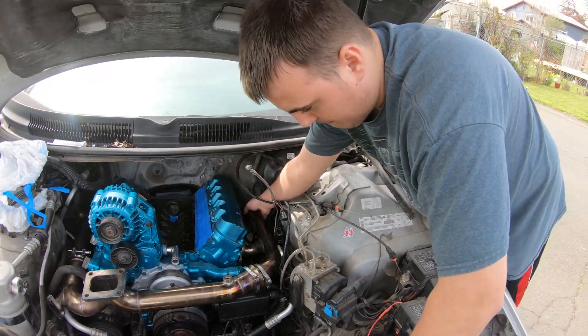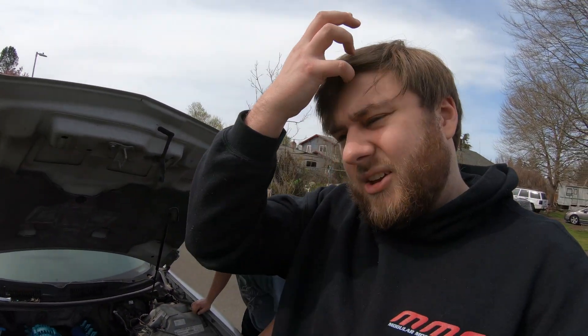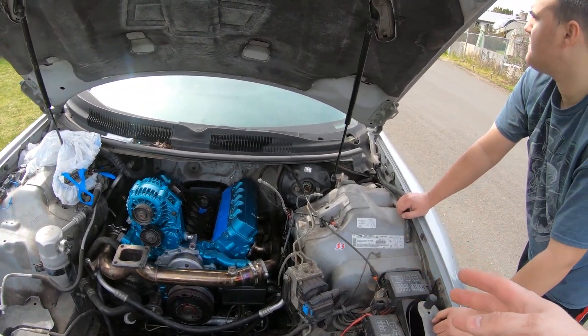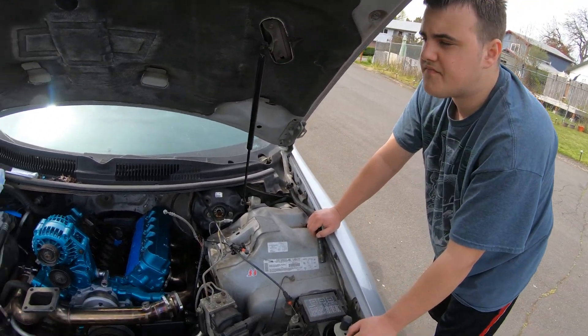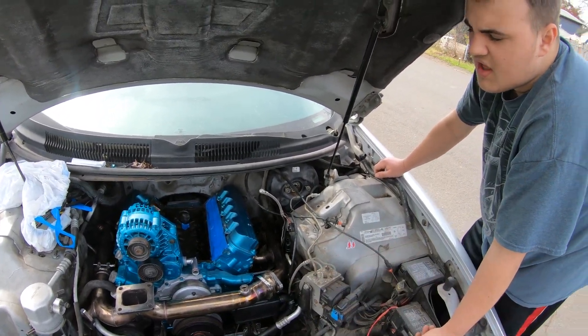We're planning on possibly painting these with actual good ceramic paint — like the stuff we used on the bottle. I found this company called Zybar, I'll put it on the screen. They make ceramic paint for headers and exhaust and other things. It's like eighty dollars for four ounces, but I'm going to message them and see if they can help us out because we want to header paint these with ceramic coating and then also wrap them just to reduce as much heat as possible.